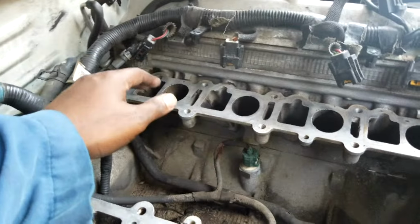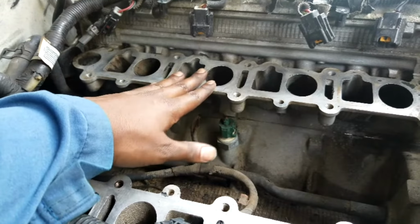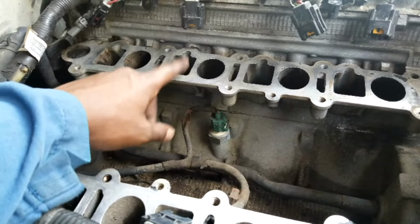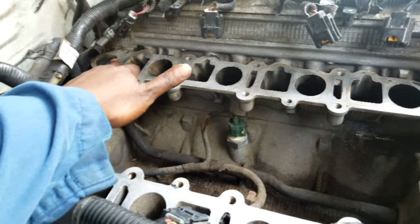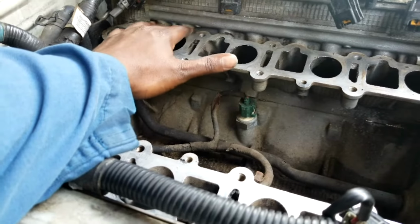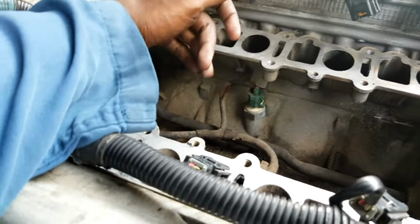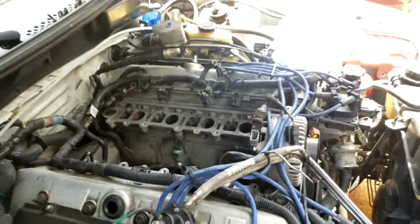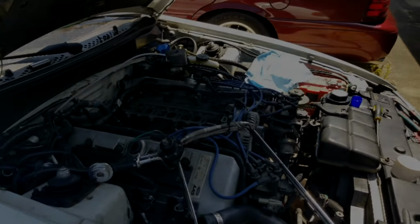Alright, I got frustrated and came in with the wire wheel, so we basically just shaved all that nonsense off the surfaces. Now, next step is I've got to vacuum every single cylinder port. This is split port because it's B heads, so I'm going to have to suck every port down just to make sure there's no debris in the engine. I just went ahead and cleared up all that RTV out of there. We'll clean the ports up a little bit more. Everything looks clean. We're almost ready to mount that bad boy on this car in a little bit.